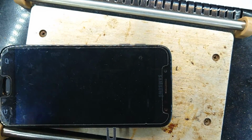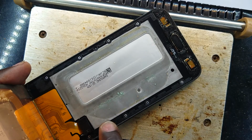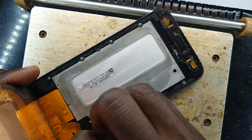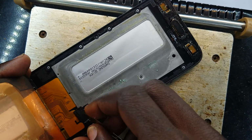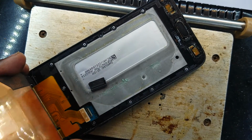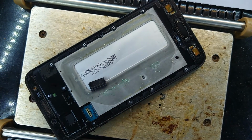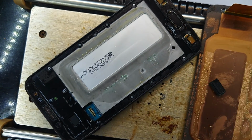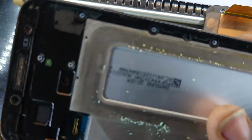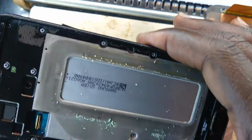So we've gotten in between, and you can see the screws right over the edges that you have to take apart. Now to access the screen, you pick out this plastic. It's the one that keeps the screen in its socket, and then this pops out like that, and this is how you open the Samsung J730 Pro. And so let's get ready to acquire a new screen for this. See you in the next video, which is a screen replacement. See you.